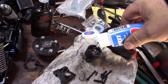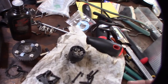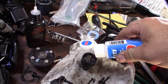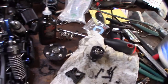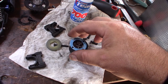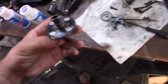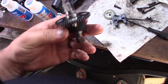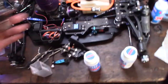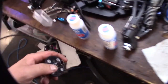That's pretty thick. Fill to the top, let it soak in for a couple minutes to get the air bubbles out, and move it around a little bit. Put a new gasket on and close it up - tap it back on. All right, got it done. At least now I'll never have to wonder if this was serviced or not. Same thing for the front and back, they're pretty much identical - just using different fluid weights.